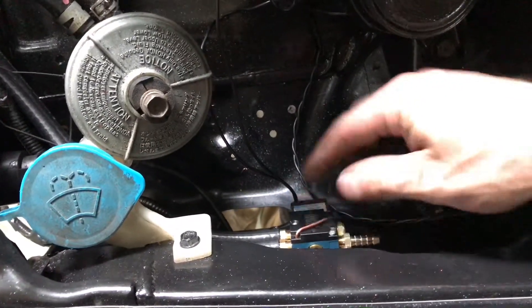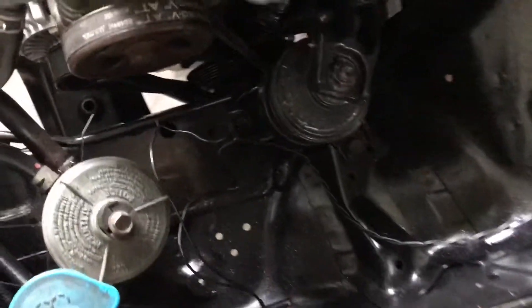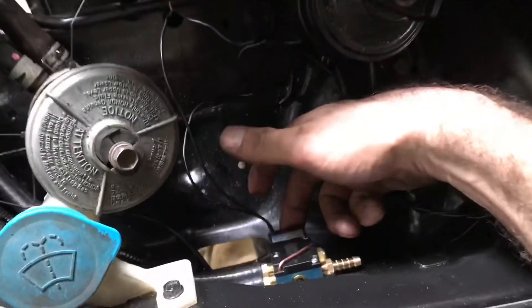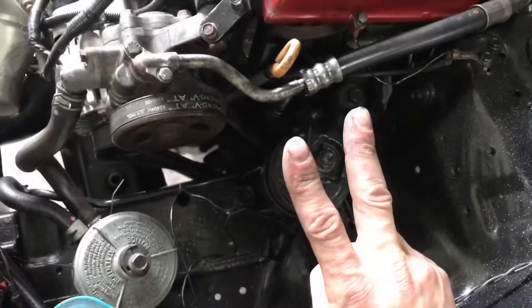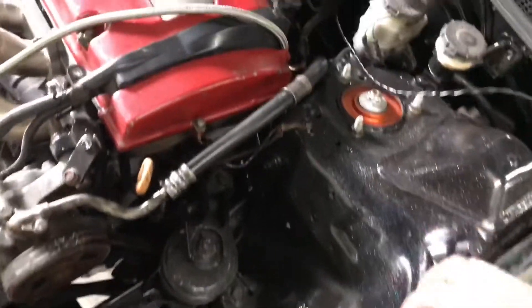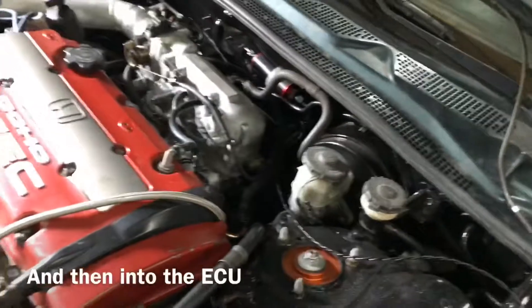I just drilled two holes, put a piece of wire through there, and then spun the wire with my drill on the back and tightened it up real nice against that inner fender. Then I took my wire, which is 18 gauge — I change the wire gauge from what looks like 20 gauge up to 18 gauge, a little bigger, lasts a little bit longer. Then I take the top of this MAC solenoid off and there's two little prongs that stick up. One's gonna be your A25 wire and one's gonna be your A11 wire. I basically just shove the wires straight down on these two prongs through the hole in the top that I drill out. I put epoxy there so these wires don't rattle off, then I run them through the hole for my cruise control straight through my firewall — that's where all of my wires have gone so far.